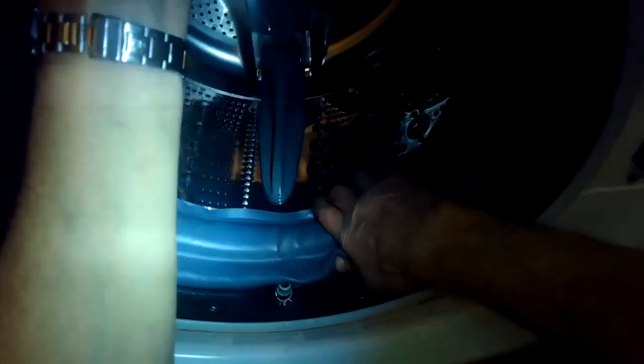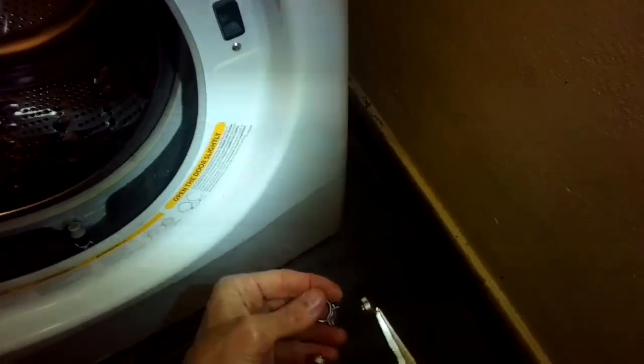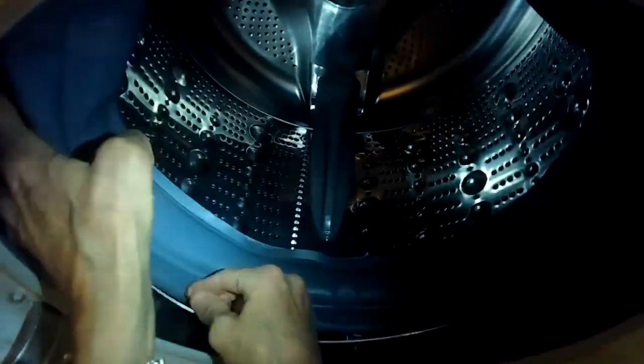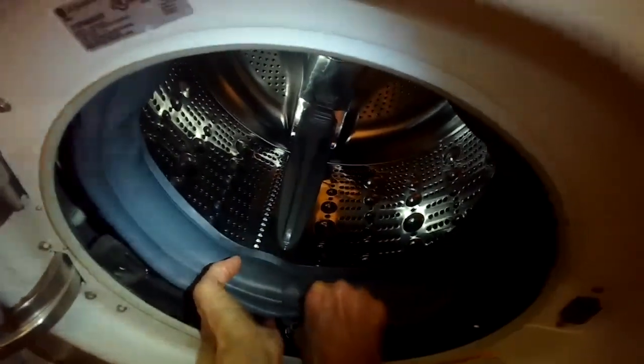Next, put on the rear spring clamp. First check that the drain hole lines up with the drain, then put the spring clamp onto the bottom of the hose — squeeze with pliers (the special pliers make it a bit easier). Now place the spring clamp into the rubber ridge all the way around the perimeter of the back of the door boot, with the spring part positioned at the 3 o'clock position to the right, then put the tool into position.